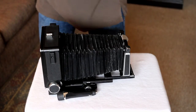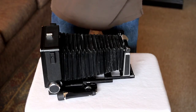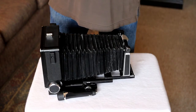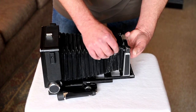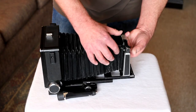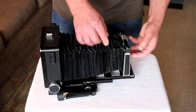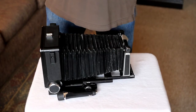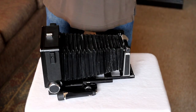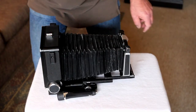Another way of doing it is with a piece of electrical tape. Since the bellows were at one point one flat piece, if you put the tape on correctly, even though it's flat, it will follow the folds in the bellows and fold in there and hold tight. That's probably the best quick way to patch leaky bellows — you can do that and use the camera right away with no waiting 24 hours for the silicone to cure. It's ugly, but other than that it works perfectly well.